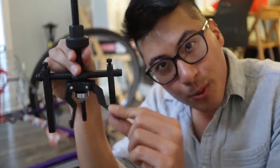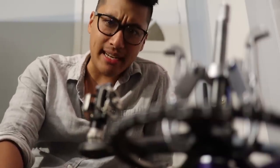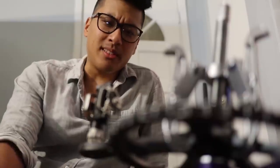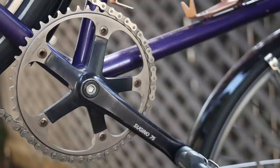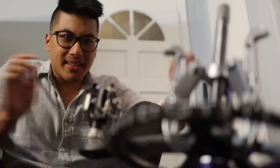The arms on this little puller can't get under because they go outward instead of inward like a claw, so I've got to go back to the store and swap it out. Part of me knows this is a bad idea — sure I can get it off, but it's a headache down the road needing a specific tool just to remove a stripped crank arm. But then there's another part of me that's like: I've been using this crankset for thousands of miles, there's nice patina where the black has faded to gunmetal — this is my crankset, and I'm taking it to the Wabi.